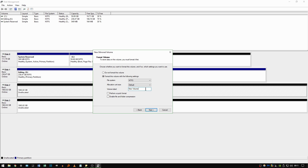Now it's asking what you want to label this volume, so go ahead and label it with whatever is most relevant to your circumstances. I'm going to call it 'Backup.' I'll just point out here that even though I named the array 'Backup,' I don't actually use a RAID 1 array as my backup, because there are complications and issues with using RAID as your backup facility. Ideally you shouldn't use RAID as a backup — I just used that name for the video.